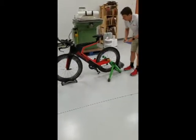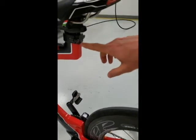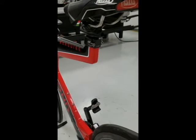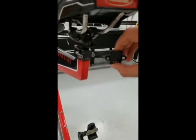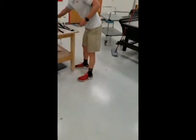My bike, because it's mine, I usually have a lot of the older stuff on it until it's necessary to upgrade. My bike says 4 Newton meters, but it does not have a threaded hole there. You can see this one that I hold up right next to it looks identical, except it has a threaded hole right next to it. That's really important. So what I'm going to do first is take off that one right there, and put on this one.